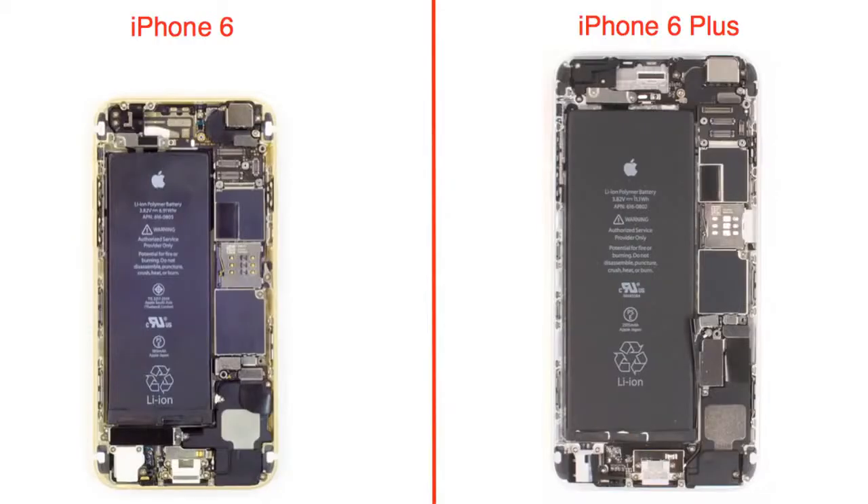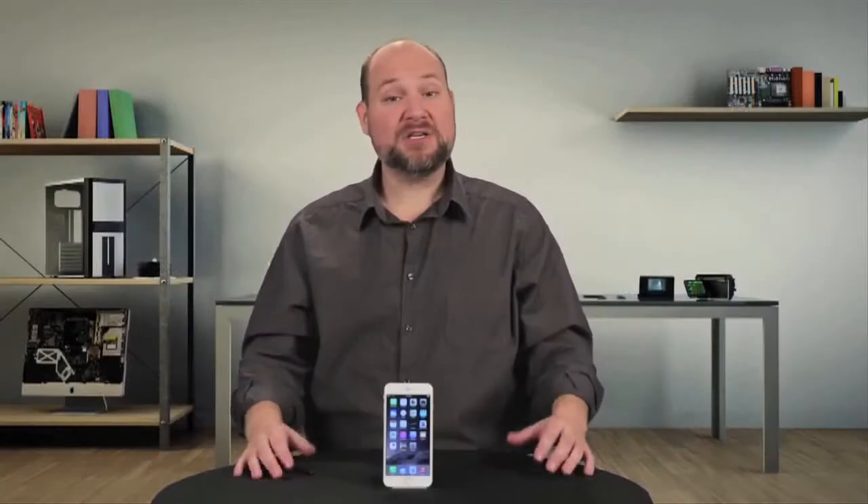As I said at the beginning, although the iPhone 6 Plus may look like an oversized 6, there are some significant differences inside the case. The overall layout is very similar, but not identical — for example, the vibration mechanisms are different and are located in different spots. Likewise, the external speakers are different. The Plus's 11.1 watt-hour battery is also much larger than the regular 6's 6.91 watt-hour unit, and the logic boards are different. If you only looked at the 6 Plus on the outside, you'd miss some really interesting and important design changes that lurk inside the phone.